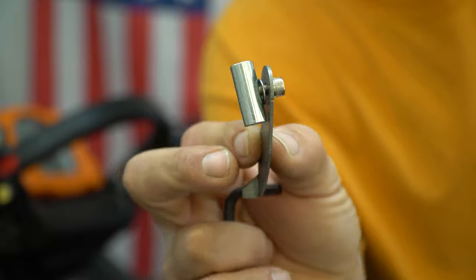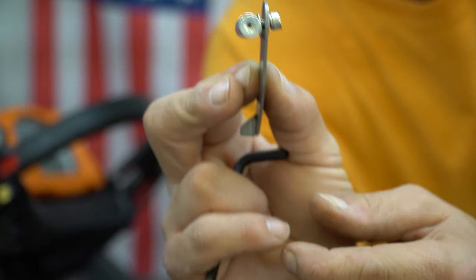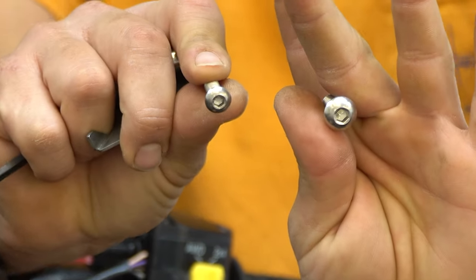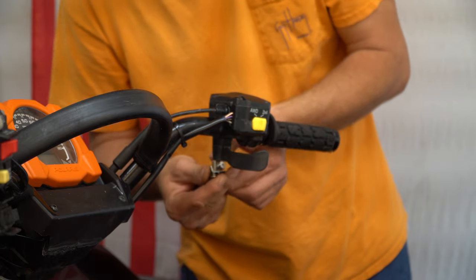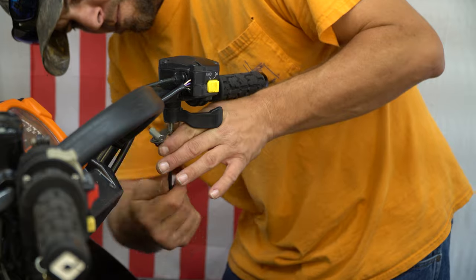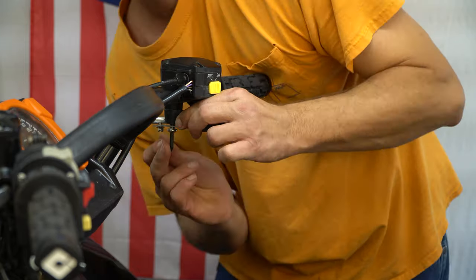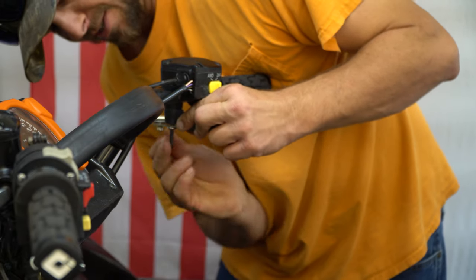It's important to mention this screw is actually the set screw for the cable, as the cable will go through this hole eventually. My kit came with two large Allen-type or hex screws. For this application it will use the larger of the two. There's already a hole in the bottom of the throttle lever that this guy is going to thread into. It took a moment to get it started, but it's threading right into the plastic. With my index finger I'm holding this piece tight and my thumb I'm holding the lever from getting away from me, so it's installed firmly.